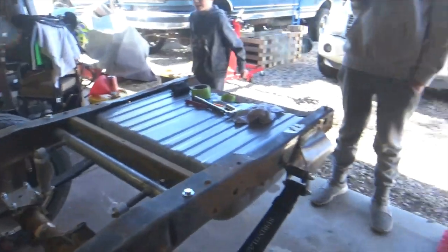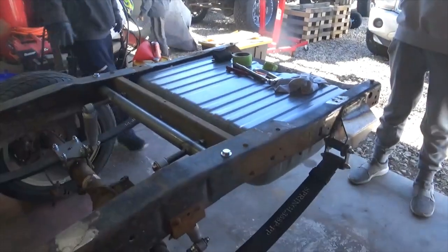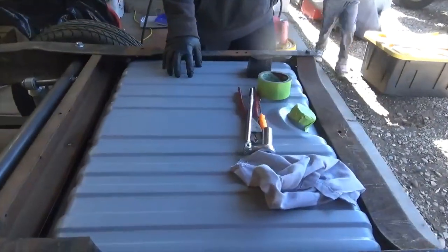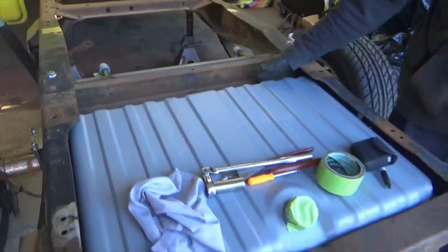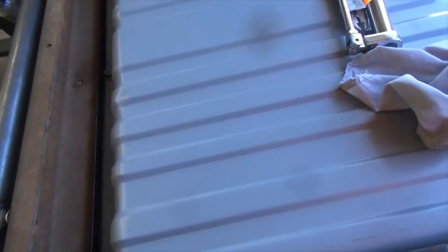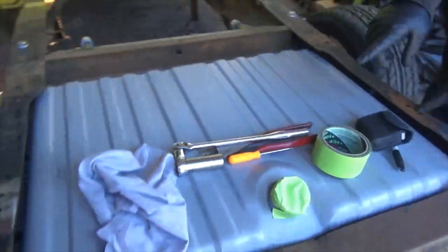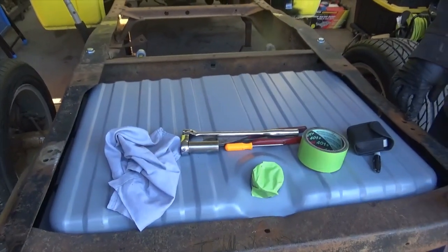This would be quick down and dirty. I've got a 1970s Ford Mustang gas tank that slides in the frame rail. I built a little angle iron holder for it that slides in on the rails, and then I'll take this cross member that's currently here, flip it upside down, and move it to the rear.